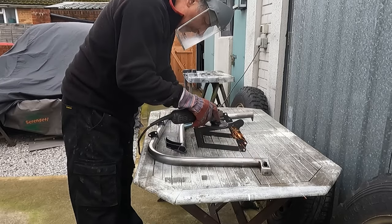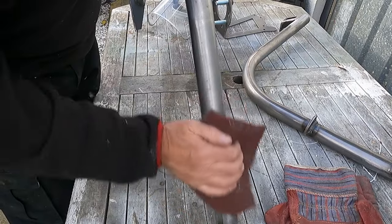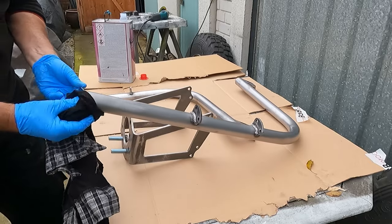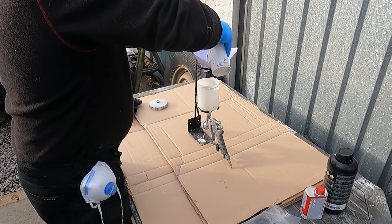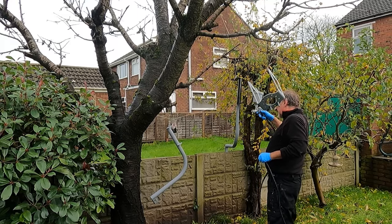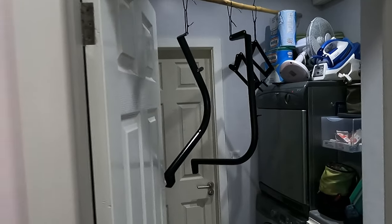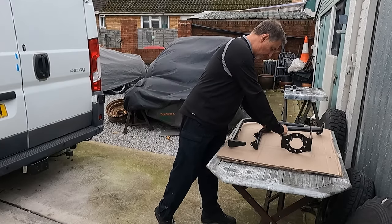After grinding off those sharp edges, the metal surfaces were polished with a scotch pad before removing any remaining residues with panel wipe. A light dust of primer was applied before filtering the two-part Raptor paint into the spray pot. With a full workshop, this wasn't my best location to spray, and I'm surprised I didn't get an absolute earful for my choice of drying room. Once good and dry, the parts were brought to the table for assembly.